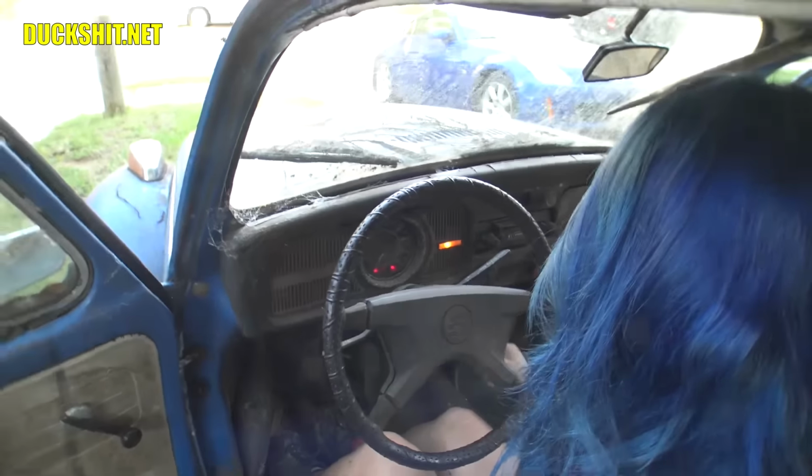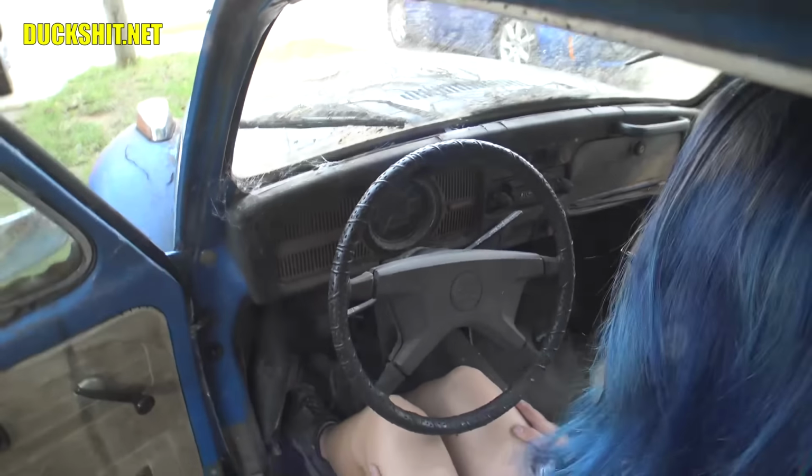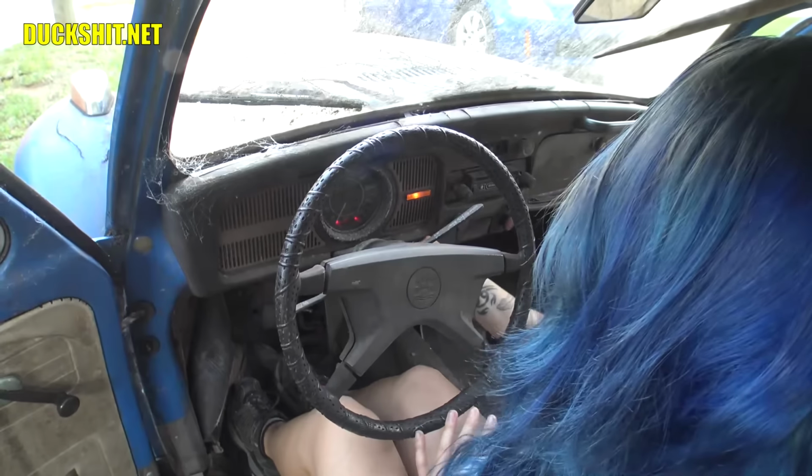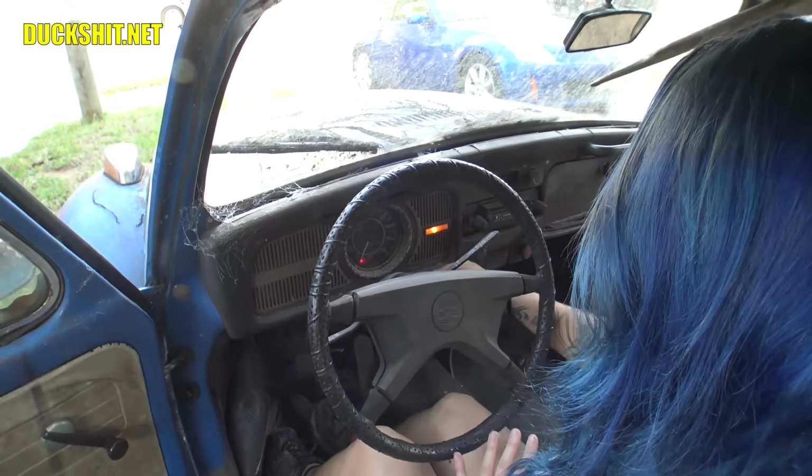All right, we might have some loose wires someplace else. Go ahead and, yep, let go. Looked like the oil light was trying to go out. Go ahead and crank it again. Holding. And the oil light went out. Good, stop. Okay, that's a good sign. That means we're getting oil pressure.